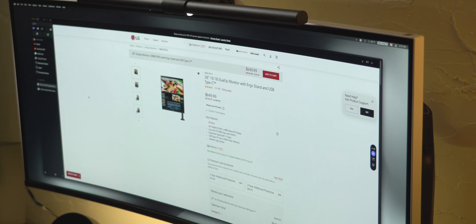Monitors with USB-C are significantly more expensive than those without. An integrated KVM switch is another feature that will drive up the price. Once you start searching, you'll realize that there are a lot fewer options for ultrawides, especially once you start looking at higher resolutions and sizes. 4K ultrawides do exist, but there are only a few options that are super expensive. Some, like the one I have here, have the same 3840 horizontal pixels but only a 1600 pixel height, so calling this 4K is a bit of a stretch, especially as the pixel density is pretty much the same as a 1440p 34-inch. 5K2K ultrawides have a closer pixel density to a proper 4K panel, but the biggest deal breaker is the insane price and them only having 60Hz versions — and once you're accustomed to 120Hz or above, anything below feels laggy.